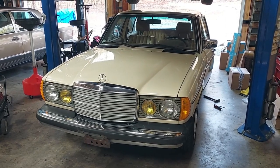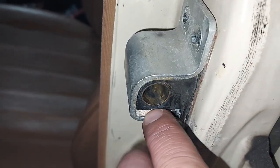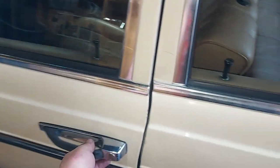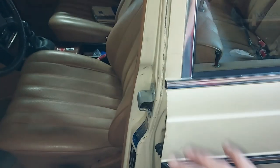Today we're back on the 82-240D. We've got to replace the little pieces in the door striker — that little plastic piece right there that rots and falls out. The rubber part is here, but that plastic piece falls out and causes the door to not shut correctly. You've got to slam them. I'm going to go around and replace all these on this car, and then come back and show you how the doors shut when I'm done.